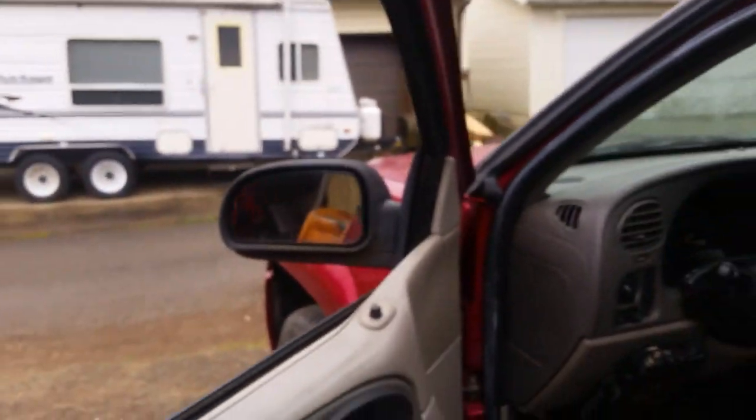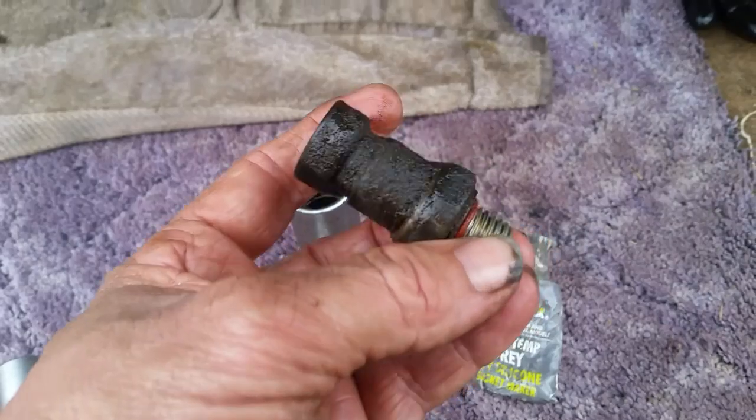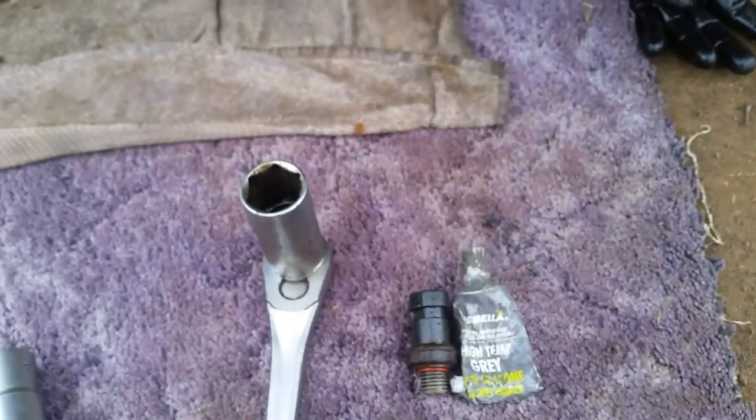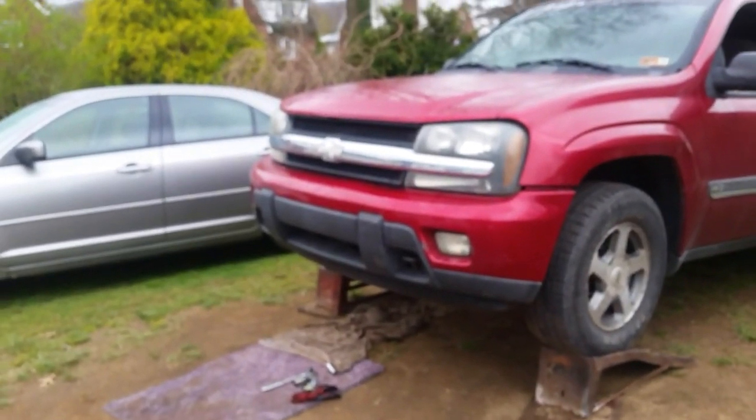Alright, it's been running for a half hour and it looks good — no more leaks. I'm a happy camper. If you have a Trailblazer 4.2 inline-6, they all have that problem. Here's what I typically use: some high-temp sealant on the threading part. You do have an O-ring on there, but it's always good to put the gasket maker silicone sealant on as well. So I hope you liked the video guys. I don't have to be embarrassed now when I park in front of my house with oil leaking everywhere. If you like any of my videos give me a thumbs up and say hi — let me know where you're watching from. Until my next video, thanks for watching and I will see you later.